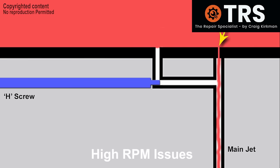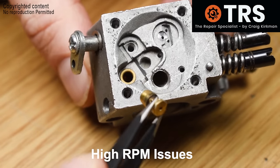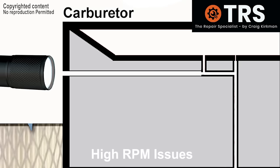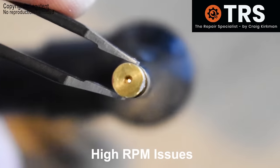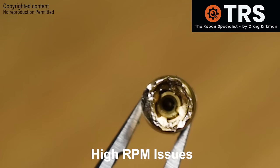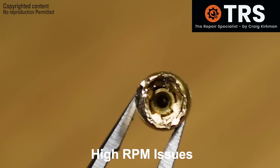So this fuel needs to be supplemented, and that's where this fuel tube comes in. It's connected to the main tube and has a wider orifice at the top. Looking at the actual carburetor, this is the orifice we're talking about, and it's much larger than that on the main jet tube. If I remove the main jet and the high screw, then dim the lights and shine a torch through the high screw hole, we can clearly see the large orifice that the fuel goes down and where it comes out to enter the side of the main jet to supplement its fuel. We can also clearly see how small that orifice is on top of the main jet, in comparison to how wide it is at the bottom where the fuel comes out in the venturi.